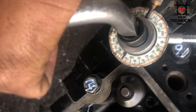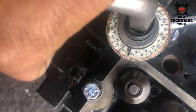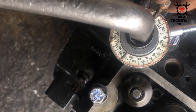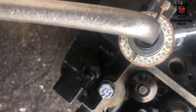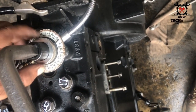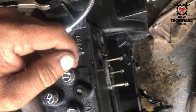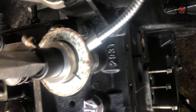This is also the medium bolt and we have to give it 180 degrees. Remember: short bolts 150 degrees, medium bolts 180 degrees, and long bolts 210 degrees, according to the engine manufacturer's manual.